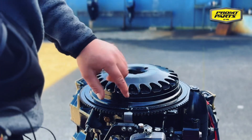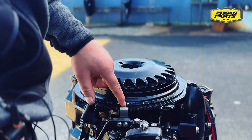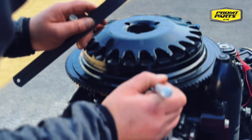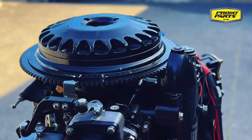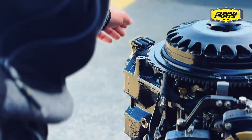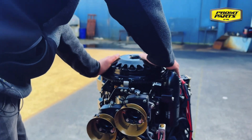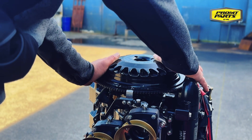It hasn't matched up with our other four centimeter mark, so what we now do is measure the distance between where it stopped and our first reference point, and we'll mark a line right there. We then relieve the piston stop tool.